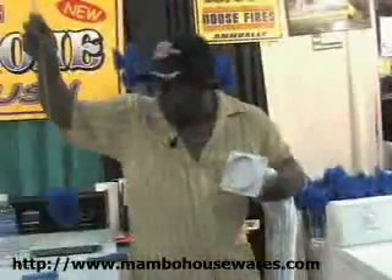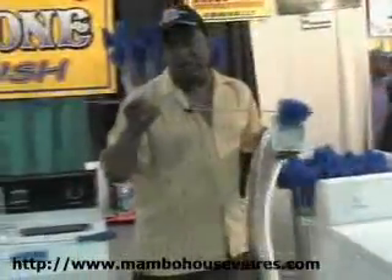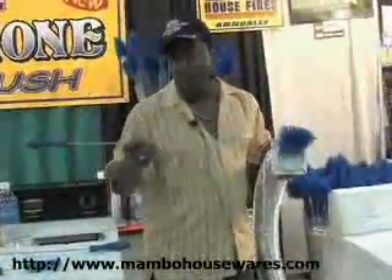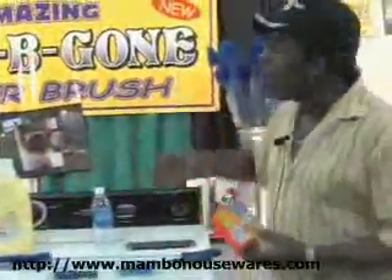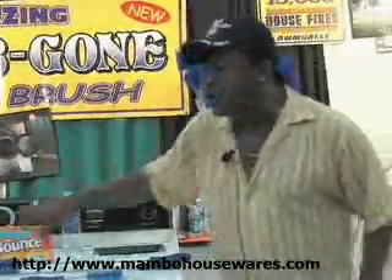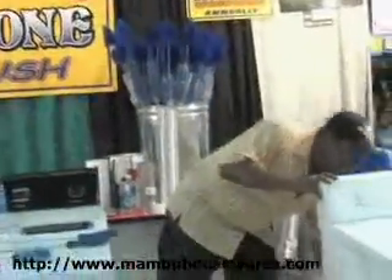Once you've done your door and the outside, you'll see a big difference in the way your machine works. Fabric softener is part of the reason we're having all the fires we are. It affects your machine in many ways — it blocks off your heat sensors and your moisture sensors that govern all machines.